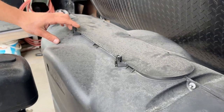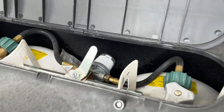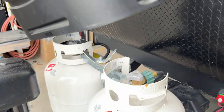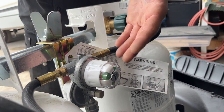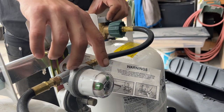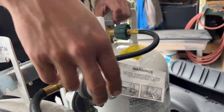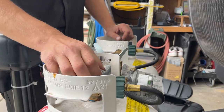It is also solar charged underneath this cover here. Pull those two knobs towards you and open it up — you get access to your propane tanks. The changeover is right there in the back: currently green, letting you know there's propane in the system, with the arrow pointing to the tank you're running off of. Once it goes red, there's no longer any propane in there. At that point, just flip over to the other side and run off that one while you get the empty tank refilled.